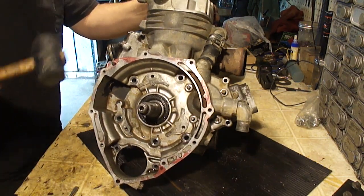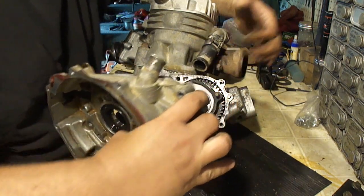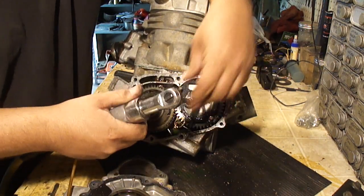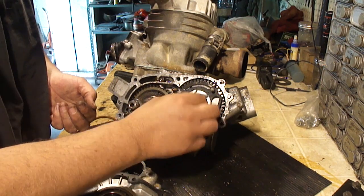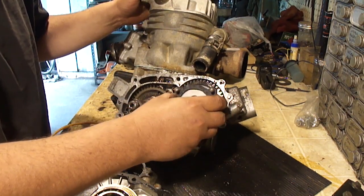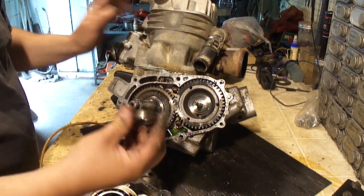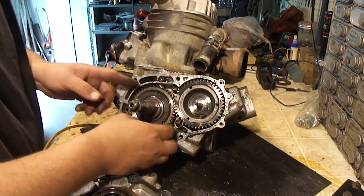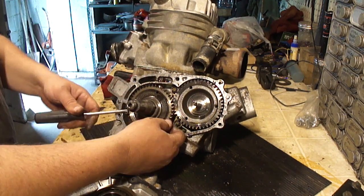There's the balancer shaft and the water pump. That's a 10 millimeter here — take this loose. There's a lock washer and then a flat washer in here; you want to make sure you put those back in the same order they came out. Now we can pull the water pump housing out. Check that bearing — that bearing is okay. Slide this spacer off, there's an o-ring and then this washer. Pull the gear off. You can see right here how these two dots are lined up — that's how you put it back in. A little wiggle and it should come off.